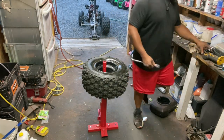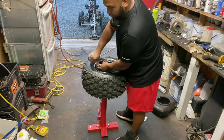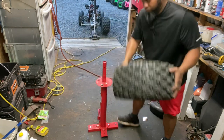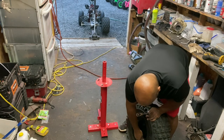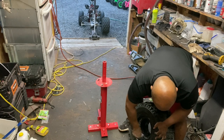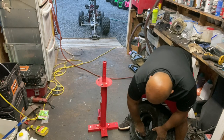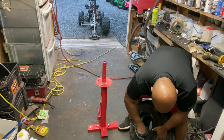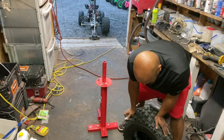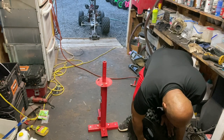Now it's time to get the ratchet out — I think I used a 12mm — and go ahead and put that second locking nut onto the valve stem and get it seated. The valve stem for tubes is a little longer than normal; there's probably about an inch of threads, so it takes a little bit of time to get it all the way down there. You want to make sure you secure the valve itself, because if you go spinning it while the tube is inflated, you can tear it off and you're back to ground zero — starting all over again and having to go out and buy another tube. So be careful with that.